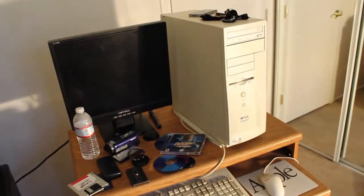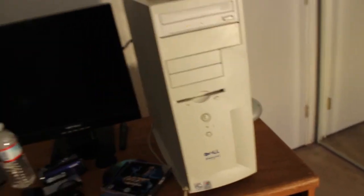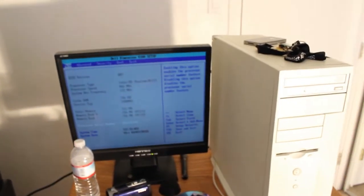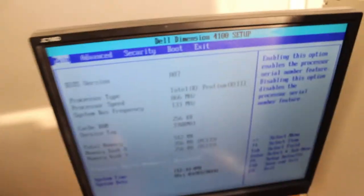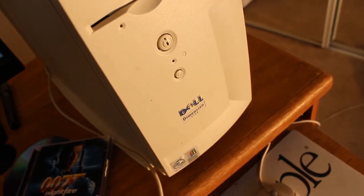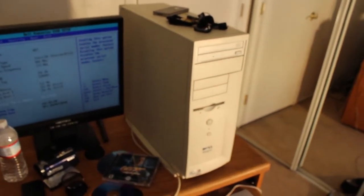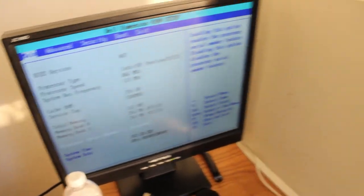It is the next day — this is day two of the Dell project. It still posts. I wiped the hard drive because I dug deeper into there and it was just people's stuff. It was running Windows XP, which I say is a disgusting operating system to run on this. Here's something also odd: Windows XP saw this as a one gigahertz CPU, yet this sees it as an 866. Could be the fact that the jumpers are overclocked, because I know that Dell offered a one gigahertz variant. What I'm thinking is maybe they shipped with the same CPU but just overclocked it a bit — I wouldn't put it past them.